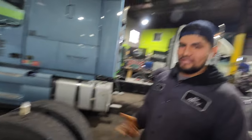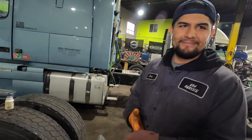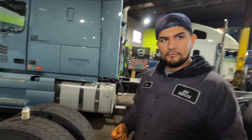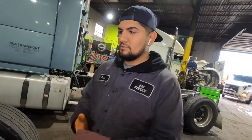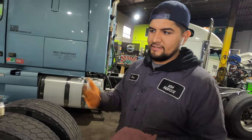What's going on over here? A relay valve that's leaking — a leaky valve. It's a combination valve, that's what's causing it to leak. The driver thought it was possibly a brake chamber, so we went ahead and tested everything with the back-feed. Nothing was back-feeding to the valve, so it turned out to be the valve itself.